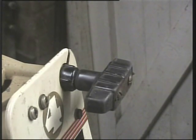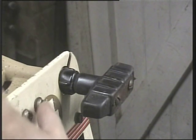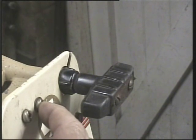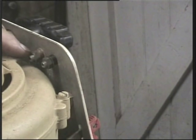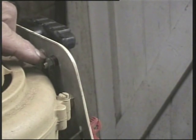Wow, this little engine is becoming more and more bizarre by the minute. I scratch me head with this one. The 2 little sockets on the front here, it's the best way I can show that. The furthest one away from you has an insulated washer behind the nut, and yet on the opposite side, which is that one, it has a metal collar behind, making that earth potential. Whereas this one has an insulated collar